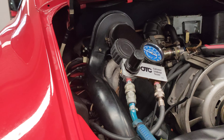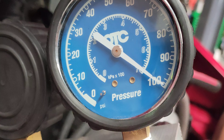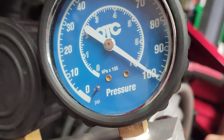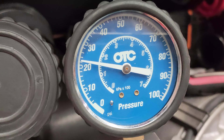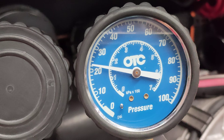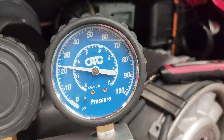Okay, Paul here with EMD Automotive. I've got a 3.2 and we're doing the leak down test. We're putting in about 100 psi which is 700 kPa, and we're holding inside the cylinder about 20 to 24 psi. Number one cylinder is sitting at 22 psi.